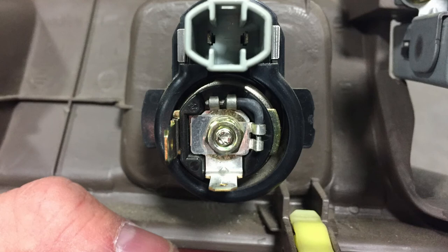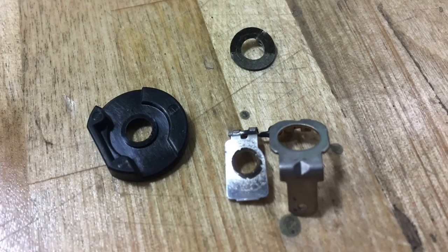This image shows a nicely intact one on the right-hand side. In order to bypass this link, you can see there's an isolation disk that runs in between the two metal plates. When you loosen that nut right there, you can simply remove that disk and clamp it back together with the nut, and the two parts are thereby joined and linked once again. So the power transmits right through the keyway, or whatever you want to call it, and right through the power outlet.